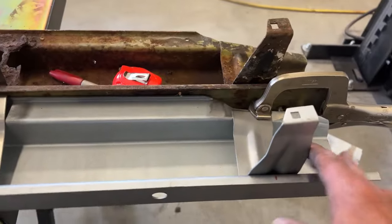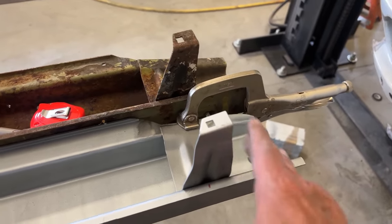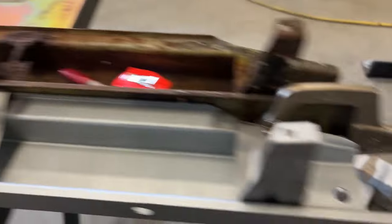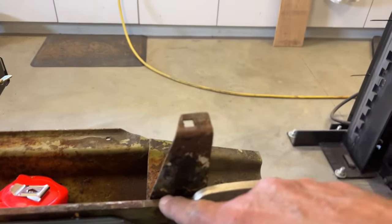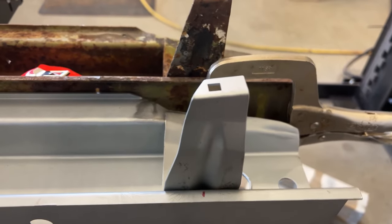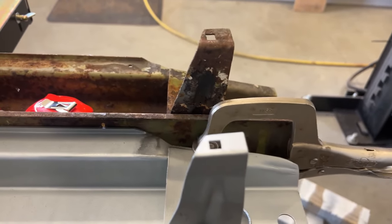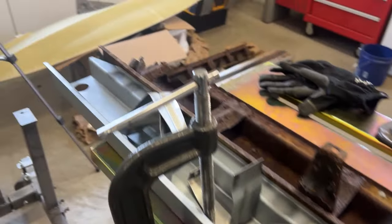What I'm doing now is laying out the driver's side, or left side, rocker molding brackets. Just lining up the old one and measuring each bracket — copying the height from the flange and the distance from front to back. Looks good. I'll keep working at it, then tack weld all of these to make sure they're in the right spot before doing the final welds.